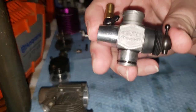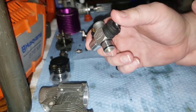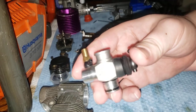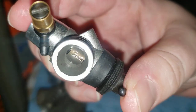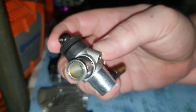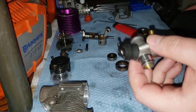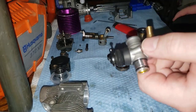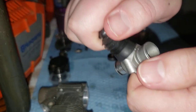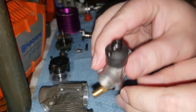So if you guys want a replacement carburetor but you can't find one for the F4.6, or it's really expensive, the SH28 P6 — being a 6-port — P6, P8, P3, or big red Dynamite carburetors will fit on your HPI 4.6. They're nice aluminum, they're really strong, they tune well, they're really good. So if you guys need one, those ones will work. And they're a two-needle too, so you have your low and your high.